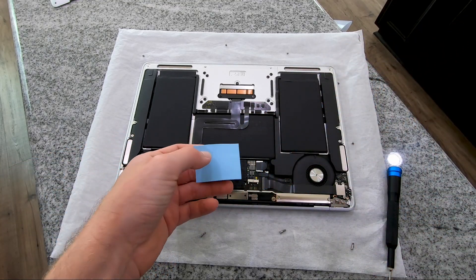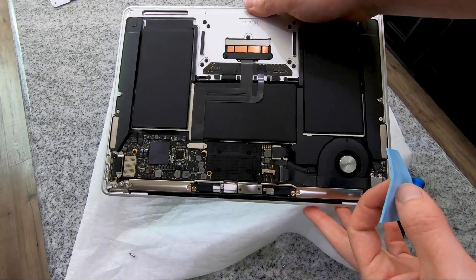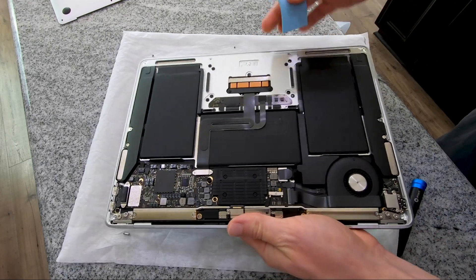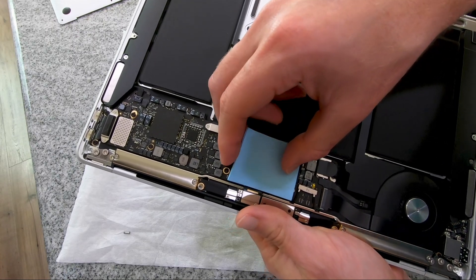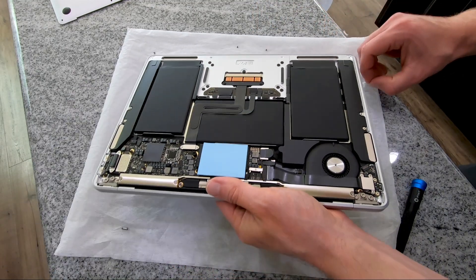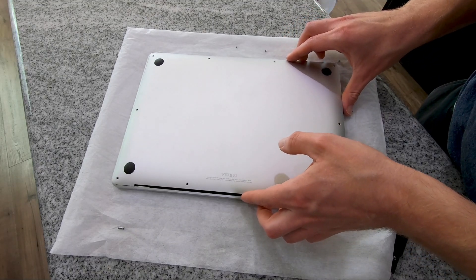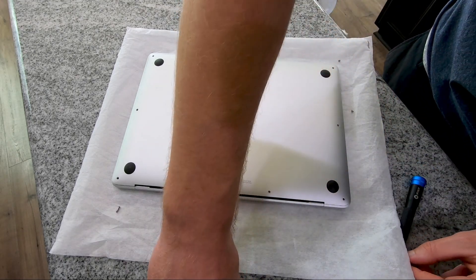You can see here is our thermal pad — I think this was a 20 by 20 by 1.5mm thermal pad. The 1.5mm works just fine. You can see there's some discoloration right here on the heatsink, and if I come over here to the base of the computer there's similar discoloration there — that's fine, it's not hurting anything. I point that out just to show it made contact. I suspect these pads are kind of tacky because they're meant to ooze oil out, similar to thermal paste. The surface of the heatsink is not perfectly smooth, and we want as much surface area as possible. I'm going to trim this down to size, lay it on top, stick the bottom of the computer back on, and apply pressure until those two tabs pop.